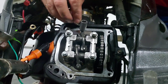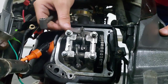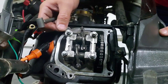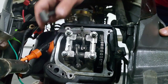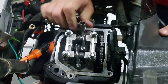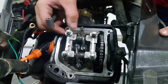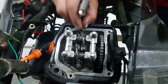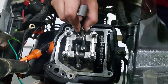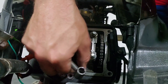Let's wrench it down a little bit more and see if we can get a good proper amount of drag while this is tight - and we got a winner folks! Slides in and out and I can feel it touching the feeler gauge, so we'll go a little bit tighter and this one is set. Perfect amount of drag. You can hear that it barely taps now - just a little bit, that's all we want, just a very small amount of play. Yeah, this other one's very loose.